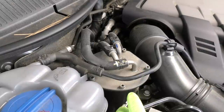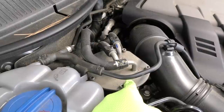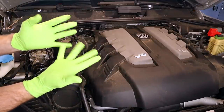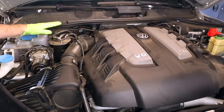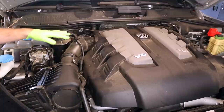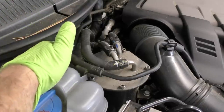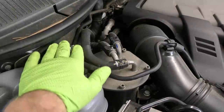A couple of things before we get started. One, we are going to be opening up the fuel system, so we're going to need to bleed the air out before we start the car up. Two, we're working with diesel fuel, which can be kind of nasty stuff, so we want to make sure we're wearing gloves and we're working clean. If you do spill any diesel fuel on any of this stuff while we're working, you want to clean it up right away so that it doesn't do any damage to any of this plastic or hoses or anything like that. And if it saturates into this firewall-protected layer right here, you're probably going to get stinky diesel fuel smell coming from your car for quite some time, so be really careful.